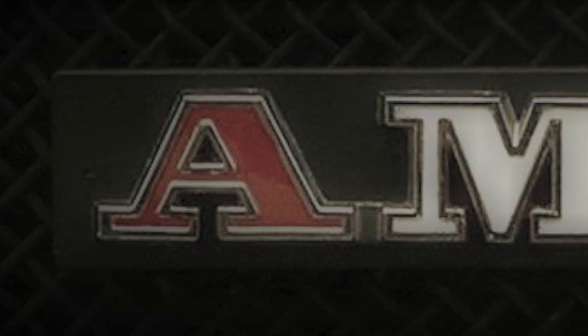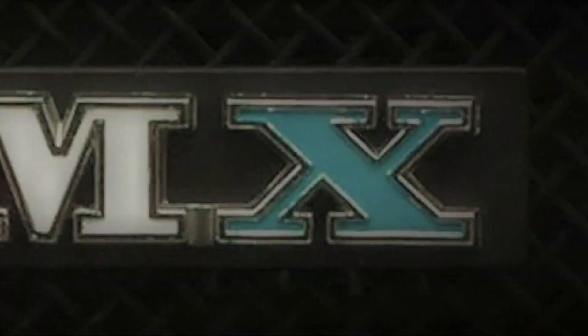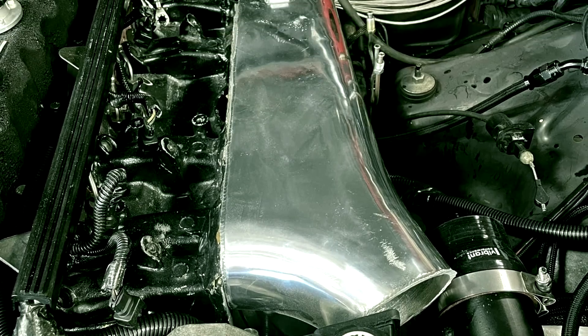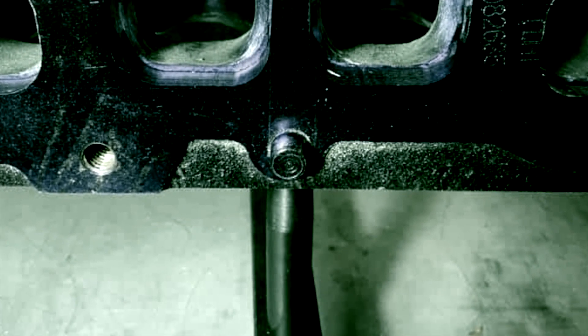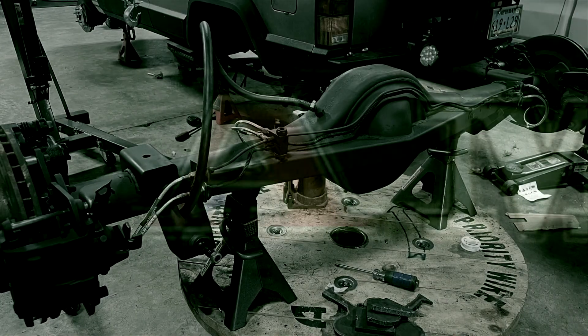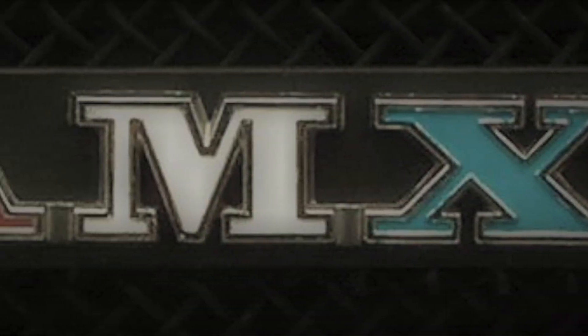The majority of the flow on a production engine is at the valve seat. The curtain area is the area when the valve starts opening off the seat — that area opening up is called the curtain area. It allows flow to come in around the valve, depending on if there's shrouding, like a bore wall right next to the valve. You're going to have some shrouding there, so the majority of flow goes everywhere away from that shrouding area. On a 4-liter, on the two intake ports that are close to each other, the wall on the port is called the common wall — it's common to the other port. They're right next to each other, and the head bolt is right through there. The outside wall is away from the common wall.